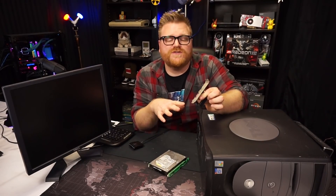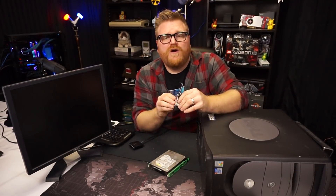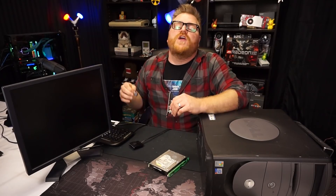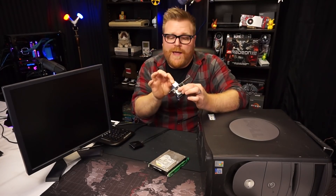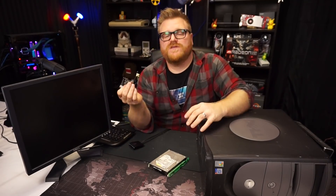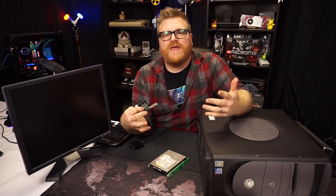Often on older computers, it's very hard to get information on and off of them. With this, it's cool — you could just turn the computer off, take the SD card out, put it in an SD card reader on a regular Windows system, transfer some drivers over, plug it back in, and boot the system. The controller does all the work — it looks like an IDE hard drive in Windows setup. As far as Windows is concerned, this is an IDE hard drive, with a little chip doing the ins and outs to make it happen.